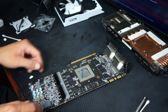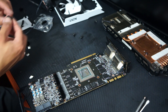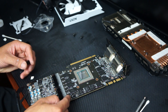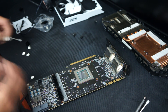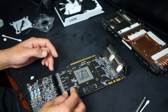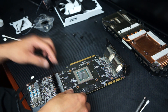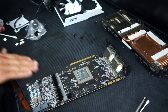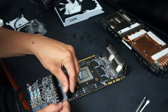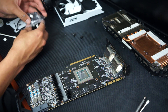There's the first row. I see a lot of people put heat sinks on the other side of the chokes, so I'm going to do that too. The chips on that side are raised up a little, and during testing some of these were touching the bottom of the cooler. The stock cooler doesn't cool these chips at all, but since I've seen others put heat sinks on them and I have enough, I'll do it — though if they interfere with the GPU die cooler contact, I'll pull them off.